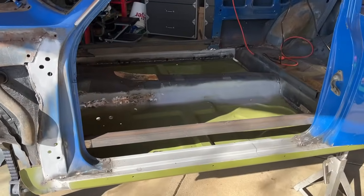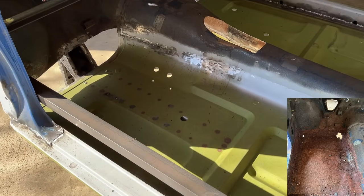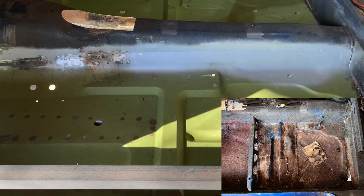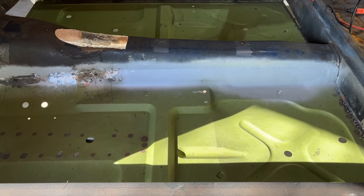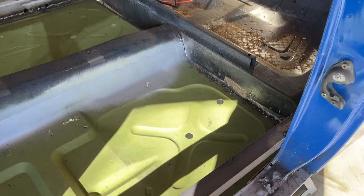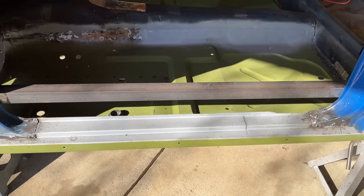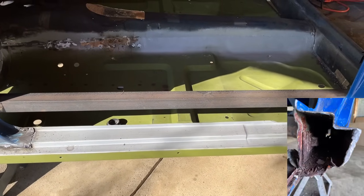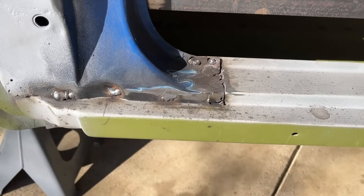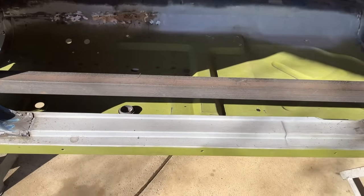The first thing I had to do was start on this side and put the new floorboard in. I didn't butt weld the floor pan - I lapped it and then welded onto it because I'm just trying to learn. It took a good amount of time to get this to where I needed it. The rocker panels come in two parts, so I did plug welds and welded those together. This isn't beautiful - I haven't finished that up yet. There are a lot of little things I'm learning on it.